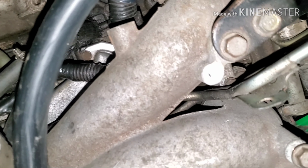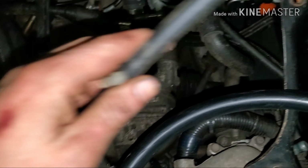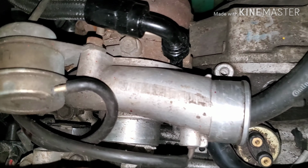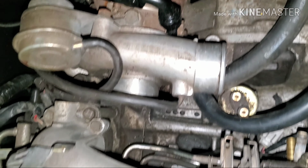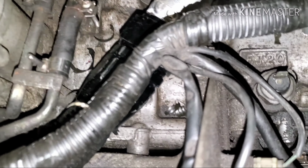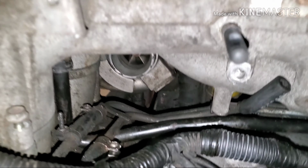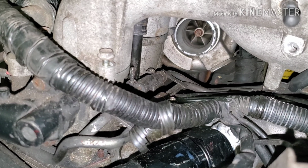Did a new vacuum line from down there that would normally go to the brake booster, I believe. So I don't know why I put the T back in. Should have done one straight hose. Either way. And then we got to run the line to where the PCV was, up to the AOS. Get this out of here. I'm a dummy, I forgot to put the inlet on, so this manifold has to come back off. Great. Unless we can sneak it in there, but I don't think it's possible. But gotta do that. Hopefully we can just maybe pull this side up enough. I don't know. But we'll deal with that tomorrow, because I'm kind of upset now that I forgot that.